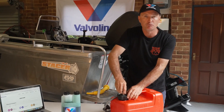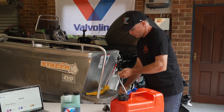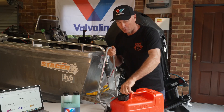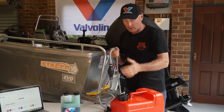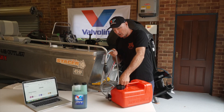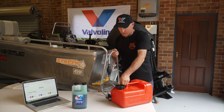Another thing — don't forget to open your breather once you hook it up to your outboard engine. This is going on a 25 tiller steer. Pump that up, get your pressure, and make sure you keep that breather cracked open, otherwise you'll find the engine will starve. When you're finished for the day, disconnect it and close that to make sure the fuel doesn't go stale and stays nice and fresh.